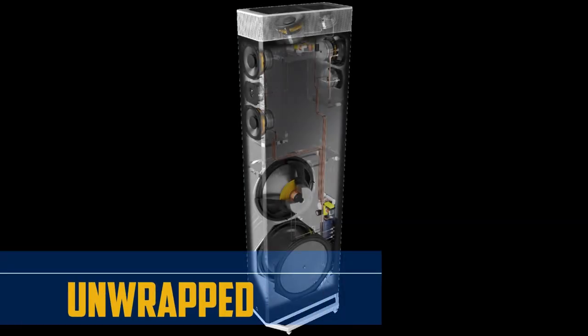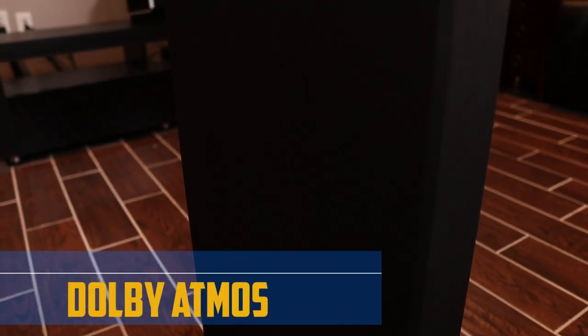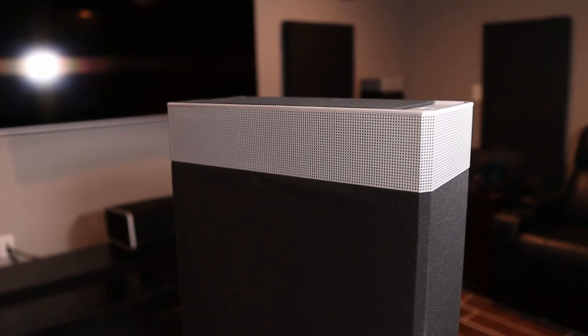The speakers come fully wrapped in a premium black speaker fabric finish. Starting from the top down, you have the Dolby Atmos height channel with a one-inch aluminum dome tweeter and a four-and-a-half-inch driver. The main front drivers include two five-and-a-quarter-inch drivers with a one-inch aluminum dome tweeter. Below that sits a 12-inch subwoofer with two 12-inch bass radiators and a Class D amplifier to power them. These speakers produce some serious low end. What makes them bipolar is the rear set of drivers facing the opposite direction — a one-inch dome tweeter and a five-and-a-quarter-inch driver — which reflects sound off the walls to create a giant, wide soundstage.